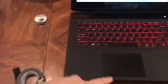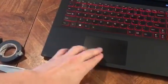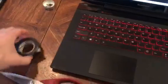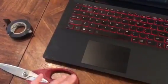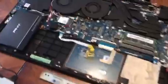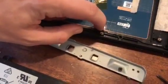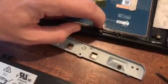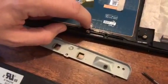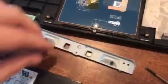Someone did online propose putting a piece of plastic in the bottom of this groove here, and it's a temporary fix — it only puts a little bit of extra pressure on the pad to contact that button better. But really it's not a good fix. Basically that little button — you can hear it, it still clicks, you hear the click but it doesn't activate, so you want it to go all the way down to actually work.